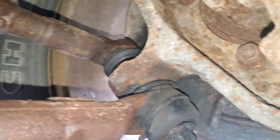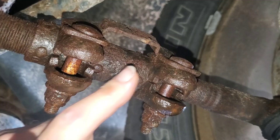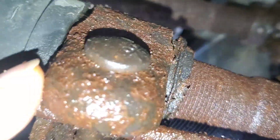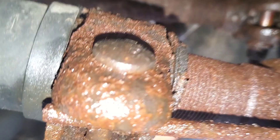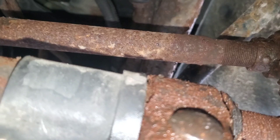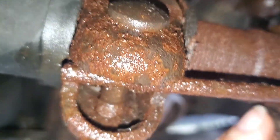These are not super hard to change. You've got one cotter pin and castle nut here that holds this on. You've got an adjuster clamp here that holds this threaded end on, and the same thing down here — a retainer clamp and a threaded rod that goes into this bracket. Once you take this loose, you're supposed to be able to unscrew it. A lot of times it gets stuck and you'll have to get a hold of the edge of this plastic thread cover and knock it backwards a little bit.